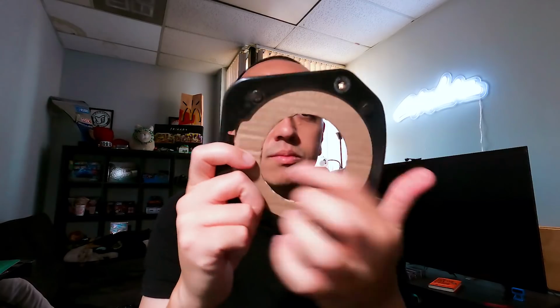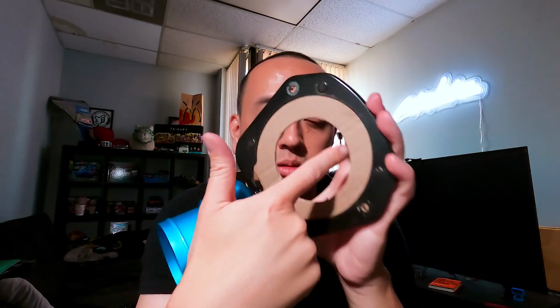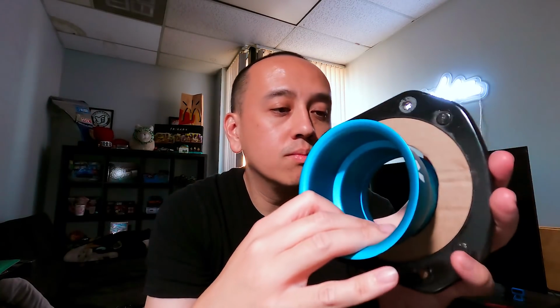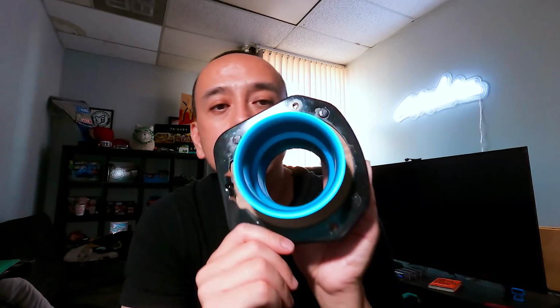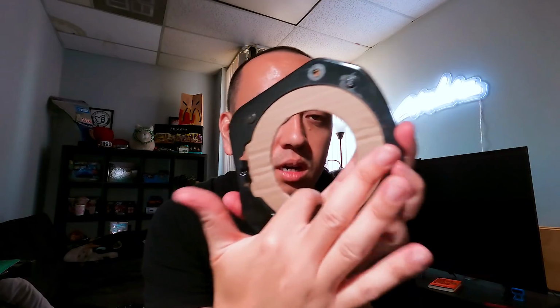So originally I cut the hole perfectly in the center, but then I realized that the way this duct is going to sit and how it mounts to the bumper, the edge might end up scratching the inside of my bumper on the top, so I cut the hole a little bit wider on the bottom. So it'll go like this onto the car, and then it's going to be lower like this. I need it at an angle too, but whoops, there goes that. Luckily that's Durr's old one. Anyways, but yeah, I cut it bigger here, and then I'll probably end up using a carbon sheet.